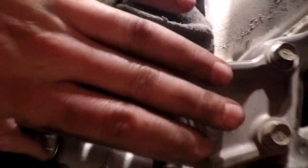And back here, where the cradle is now starting to hold more of the weight of the transmission. So I am going to loosen these a little bit more. I'm going to get my floor jack under here, and I'm going to put it right there. Probably put another block of wood there and just support it there. Well, it might reach. We'll see.